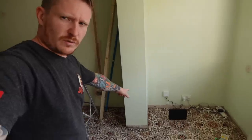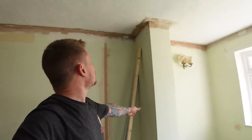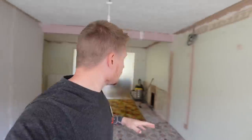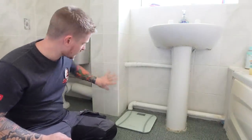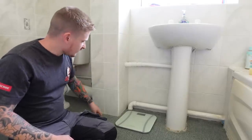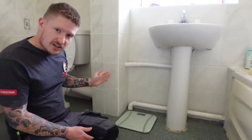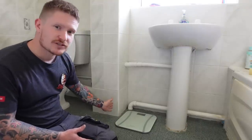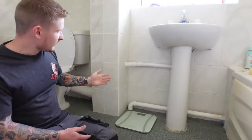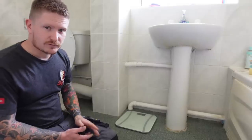My cable route is going to be up the wall from the corner. I'll probably drill all the way through this pillar, come out the other side, run a chase up to the ceiling, drill through the ceiling, and then I'll be up into the floor space. If you've got a box section with possibly pipes from the toilet or sink going into it, that is a stack with a soil vent pipe inside, and there will be space inside that box section around the pipe. That will typically run from your ground floor all the way up to your roof, so you could use cable rods to push the cable up through different levels of your home and then bring it out in the floor space. You don't have to chase walls in every scenario.